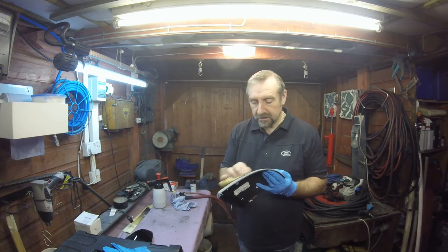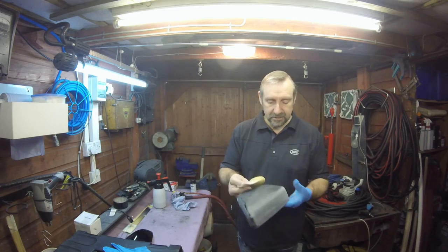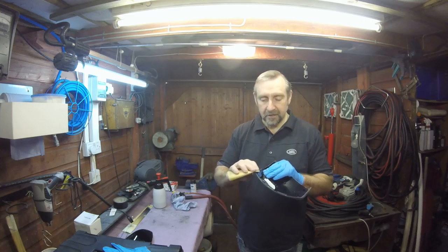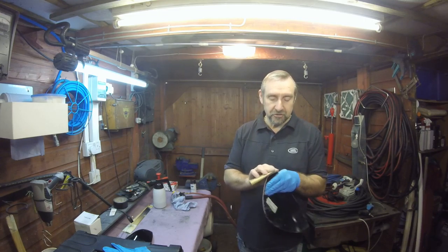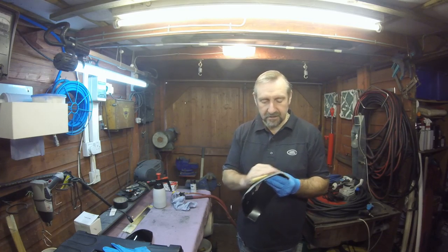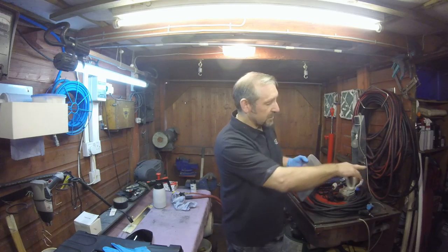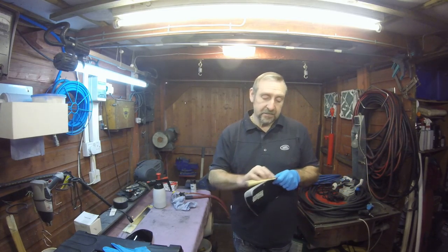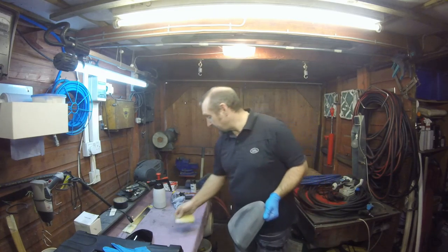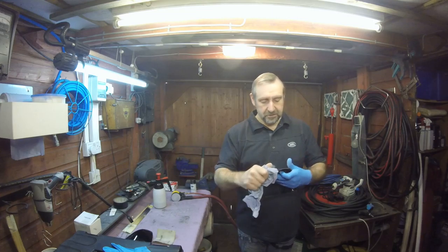Because we're dry sanding, the shiny bits that are plainly visible mean we can instantly see our progress. You don't need to wipe muck off your part and wait for it to evaporate and dry — you can see your progress instantly. I'm a big dry-sand fan. All my sanders are equipped with vacuum hoses. I've got a Sealey extraction unit — a fantastic little machine that senses the pressure of the airline. When you stop sanding, it turns off. When you start the airline back up, it senses the pulse of air going to your sander and turns the vacuum back on. Terrific thing.